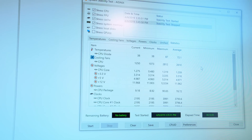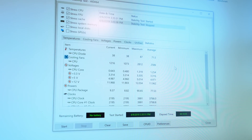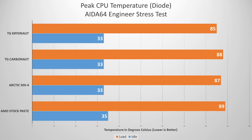Still, I think you'll be impressed. Our Ryzen 5 2600X was overclocked across all six cores to 4GHz with a 100mV offset from stock. The BIOS fan curve was set to max RPM to eliminate potential compensation when temps reach certain levels, keeping all scenarios at the same level of cooling during burn-ins. Despite the IHS coverage setback, we ended up with nearly identical peak core temperatures between the pad and Arctic MX4: 88°C versus 87°C.